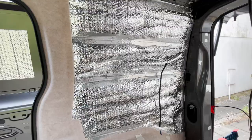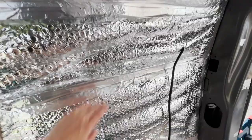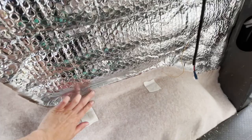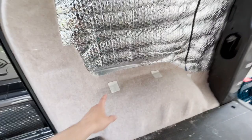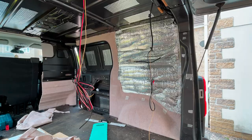What I'm going to do here is make a shelf that's going to be in this small panel. First I need to figure out where these beams are so they're going to be the main fixing points — there's one here as well, so that's going to be fixed along there. I've got some tape and then I'm going to put the panel in place, measure up from these points to the beam. I've got these little marks where those tapes were, measure up, put a point, draw a line — that should be where the beam is and then I can figure out my shelf from there.